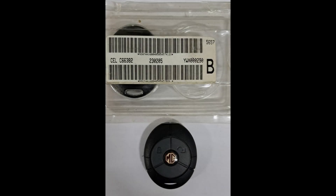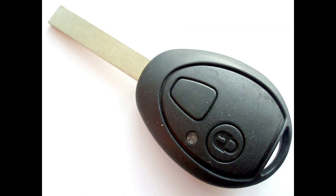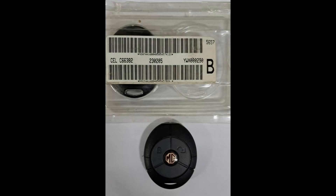A design flaw with the round Pektron key fobs means that they can actually become corrupted by other key fobs nearby that use a transponder, including most BMW keys, and as a result those used on the 75 and ZT, along with modern keys from other manufacturers. The only solution is to code a new fob to the car, and this must have the barcode information present. You can't reuse old fobs, as without the code supplied when new, they can't be added to the BCU's memory.